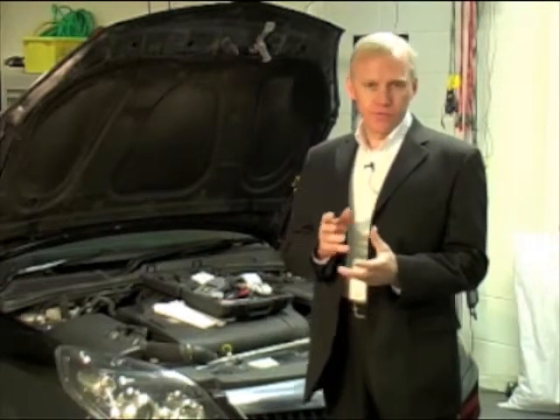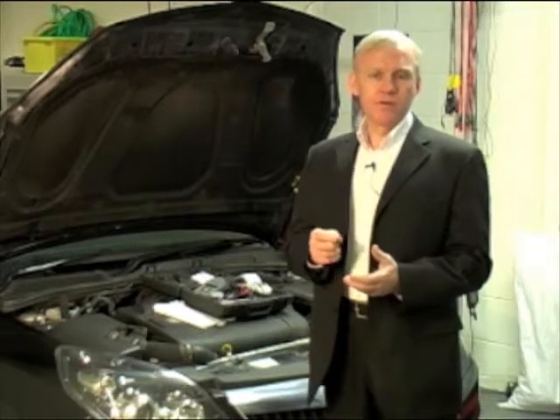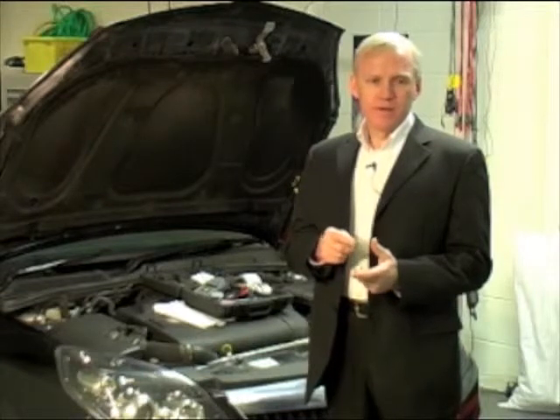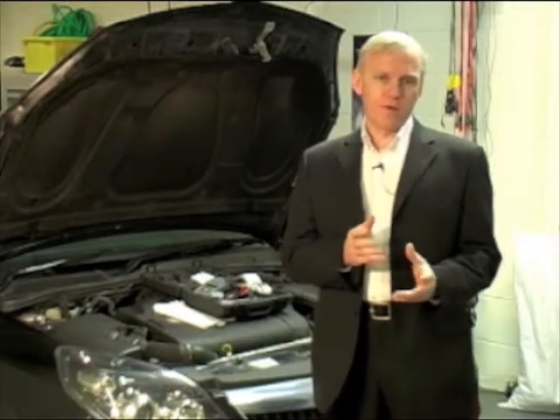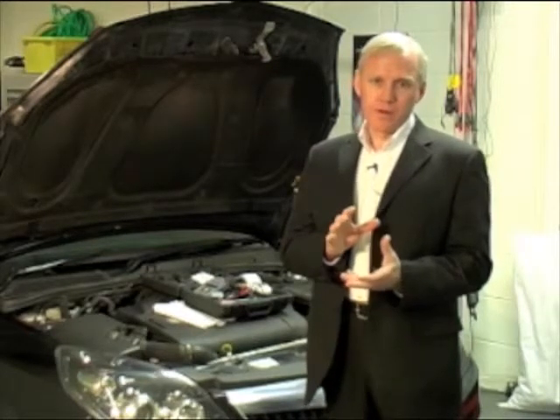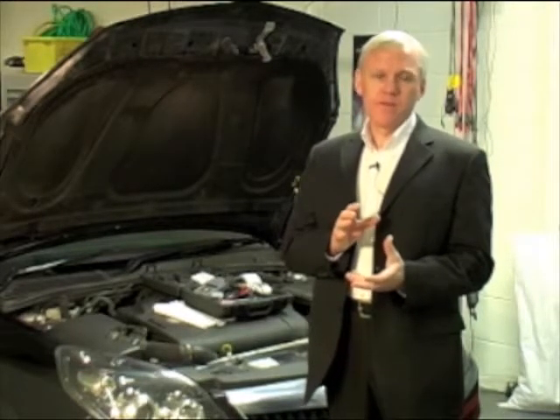This can happen during prolonged braking or stop-start driving in town when the high heat generated by braking is transferred through the brake hardware to the fluid. In modern vehicles the aerodynamics are now superb, but this means there is now less airflow underneath the car to help cool the brakes. The brake hardware is now smaller and lighter, which means there is more heat transfer through to the brake fluid.